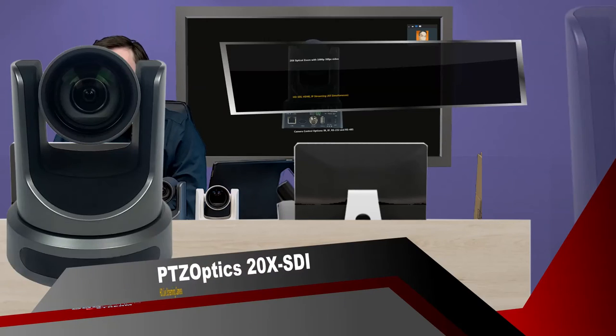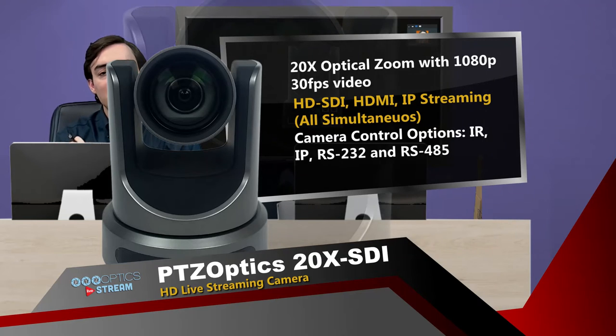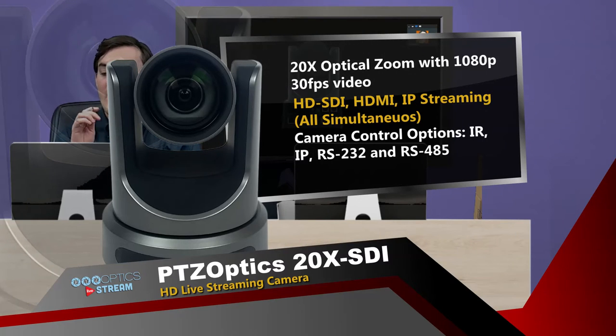So let's quickly take a look at the different features. It's got 20x optical zoom and it's a 1080p 30 frames per second camera. We have HD SDI, HDMI, and IP streaming, which are all simultaneous. We've got the IR remote control, which can control up to four cameras. We have the IP control, which you can set a static IP address for this camera and log right in and control it. You can also use our open source control software. We've got ready-made IP controllers for broadcast, education, corporate, and houses of worship. So those are just ready to go.